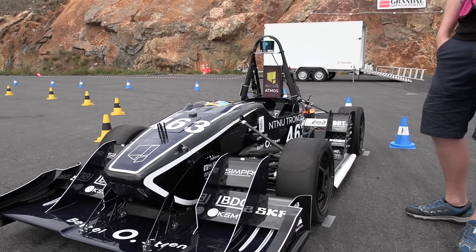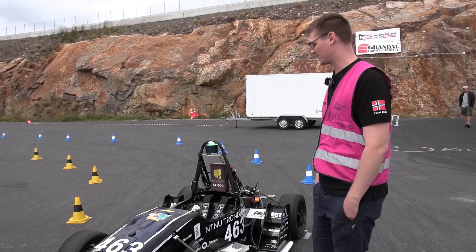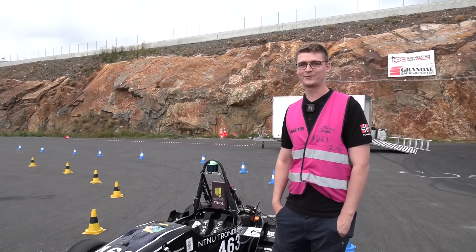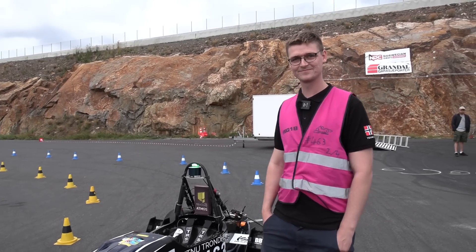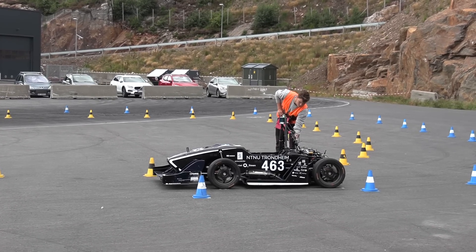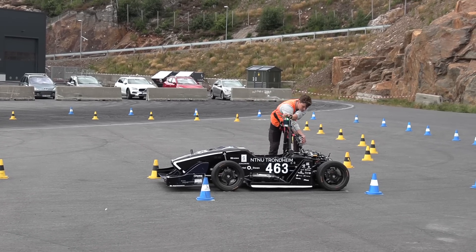Do you have any cameras? There are no cameras — we found out we don't need them. Simpler is better. The LiDAR is really good, and for this purpose it's perfect because the cones are basically what defines the track. The goal is to hit as few cones as possible and drive as fast as possible. That's the operator — he has a remote kill switch; in case the car runs wild he can just stop it and it will lock all four wheels. He's now preparing to go without a driver.